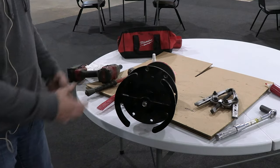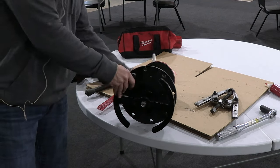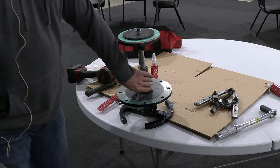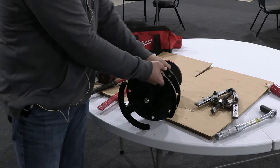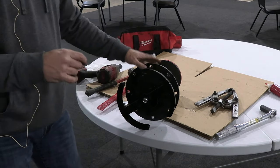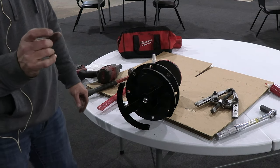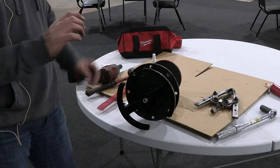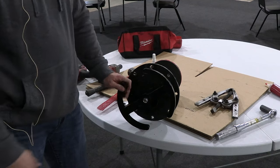When you're done with all that, just reinstall it back into the tank valve after cleaning up the old gasket off your face plate and on the tank, and reinstall it. After it's back on the truck or the trailer, go ahead and shut the valve all the way and put the tank gauge indicator on there that shows the tank is closed. The sticker is on the back of the trailer.